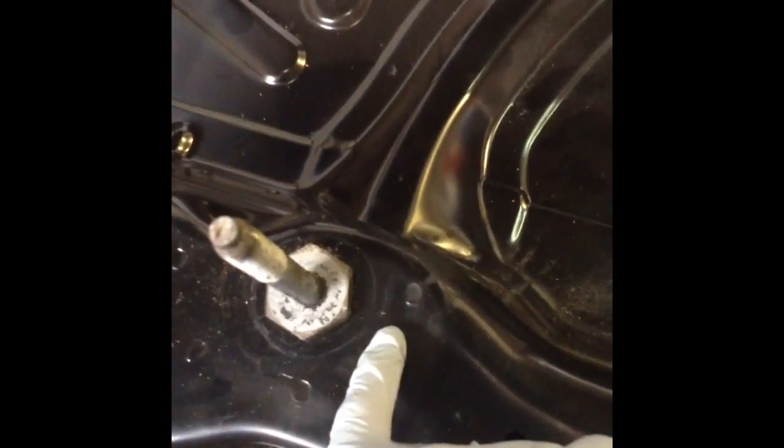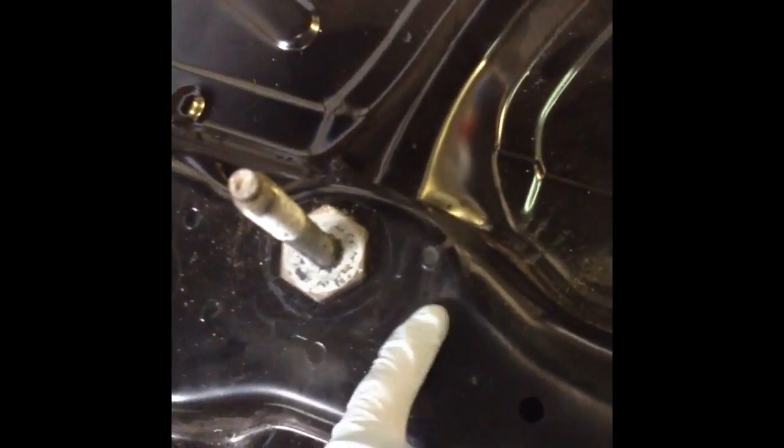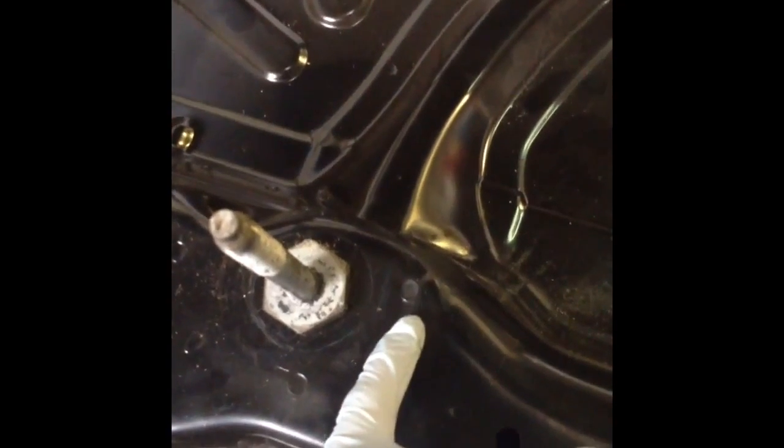Interestingly it was this side here, and the spot weld was here about where my finger is, because the bush used to absolutely touch it. The black marks used to completely cover the spot weld, and now the spot weld has been moved — moved outboard slightly — still doing its job and containing the inner threaded section, but they've moved all these spot welds slightly out.